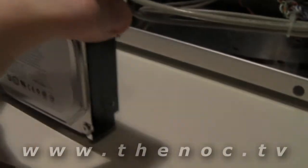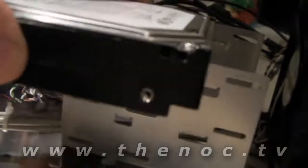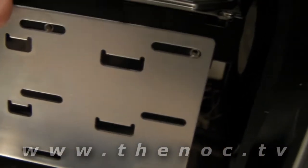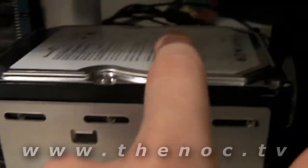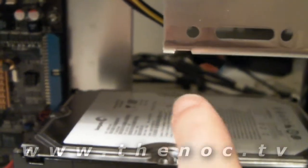Go ahead, take your hard drive. Just simply, if it's on the top one it's pretty easy - just set it on there. You've got that little piece of bent metal like I was telling you before with the CD drives, and just set it up on there. The back and forth play on it is going to depend on your board, but I try to keep it pretty much straightforward in the middle. To make this install simple, we're going to use two screws here, which should be sufficient. Your motor's there, it's going to balance that out perfectly fine, and it makes it real easy because on the other side there's nothing, which means we don't have to take this thing out to mount it.